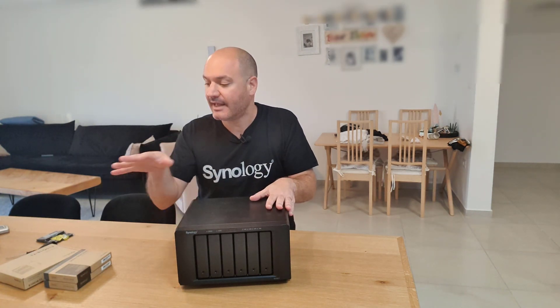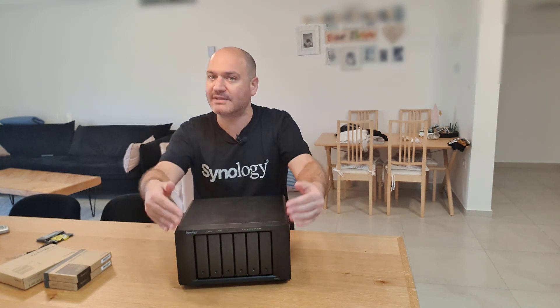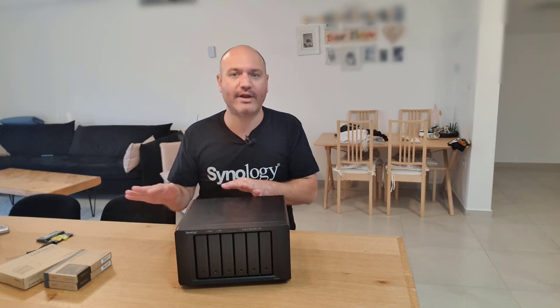First thing I really recommend to everyone who buys a Synology NAS and wants to upgrade it right off the bat: a lot of people buy a NAS device along with SSD caches, network cards, or RAM. The first thing you should do is plug in the device as-is, put some drives in it, plug it in, see that it loads, install the operating system, do the updates — everything you need — and only then install your upgrade components. I've seen Synology models where if you install components before powering on, it doesn't accept them and doesn't load.